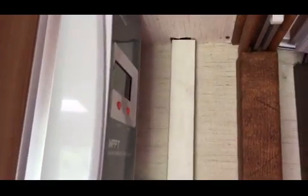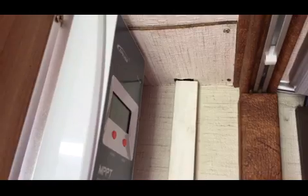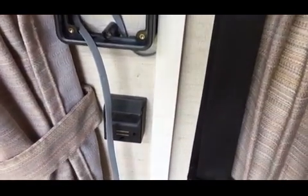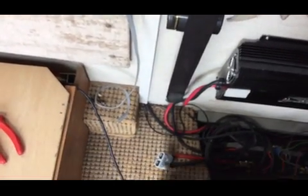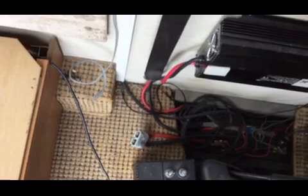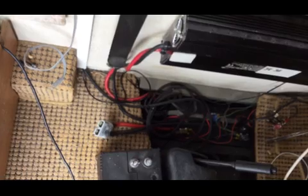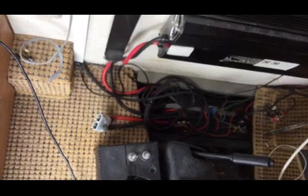So I've hidden all the wires in this conduit coming right down from the roof, so that's where the hole was. Boarded up and the gland's on top anyway to watertight seal it, and then all the way down past the MT50, the seat belt, right down to the floor there, and then just to the right where all them red, black and all that spaghetti wiring is where one of the leisure batteries is, to the left of the handbrake, and the other leisure battery will sit on top in a battery box.